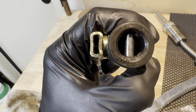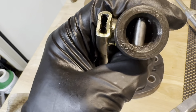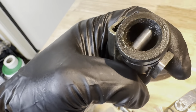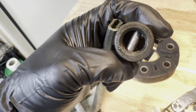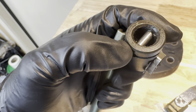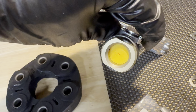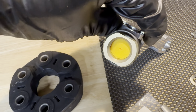If you also look at the selector joint that I removed from the car — pay attention to the inside. There's supposed to be a piece of foam, and I think it's completely disintegrated. It's probably years of wear and tear and fluid contamination that just dissolved the foam or sponge. And if you look at the new one, the foam right here is nice and fresh, and that probably gets rid of a lot of the play we experienced with the shifter.